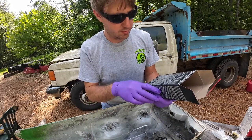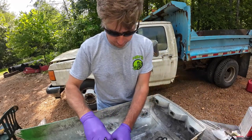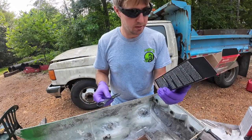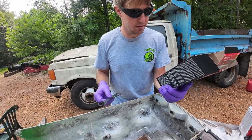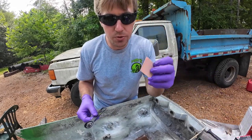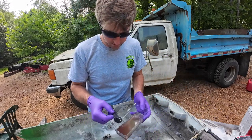The instructions say six tablespoons of resin with a quarter teaspoon of hardener. It recommends brushing it on, so I just have a really inexpensive paintbrush. Instructions say to brush a coat of mixed resin on the damaged and sanded area, place a layer of cloth, and use a paintbrush to saturate the cloth with a dabbing motion. They did include a little squeegee too to remove any air pockets if needed.